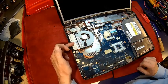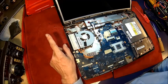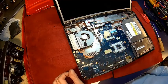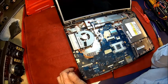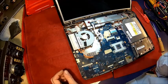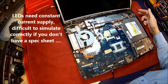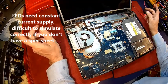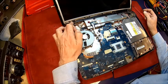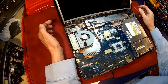Also inside the heatsink here there might be some dirt. Having an LED backlight changes the whole thing because you can't really test the inverter by supplying extra voltage from somewhere else, so we need another plan. It could be a poor connection, it could be a faulty cable, because obviously this cable is going to bend and bend and bend all the time, so it's quite possible that this cable is broken.